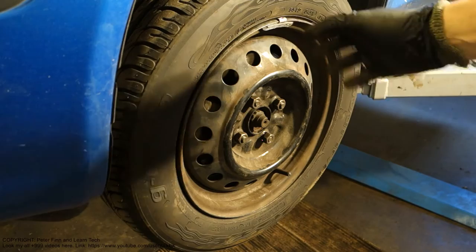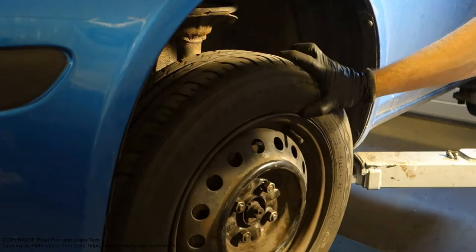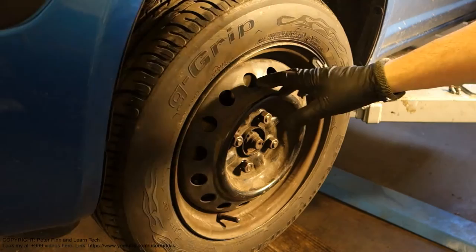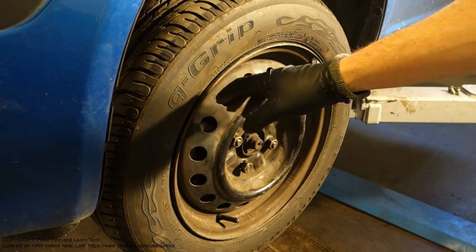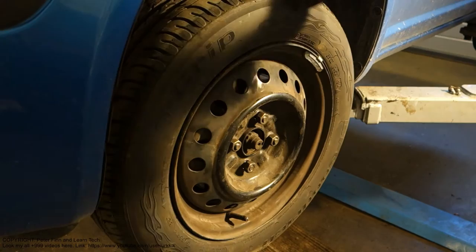Normally, if everything is okay, this wheel should rotate when we take it with our hand like this, and when we move the wheel with big force, it should move easily. Now this front wheel of mine is stuck, and stuck and jammed means that those brake parts are in contact. There is some issue and they are bad. Normally there is corrosion, they are burned out, seized, and there is no lubrication oil in these brake parts and systems. But then I will show what is normal rotation, because this is not. When I take a grip, it stops immediately.